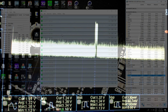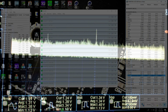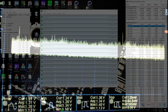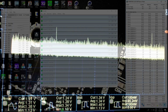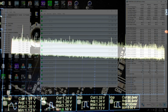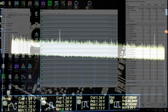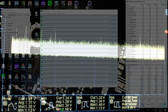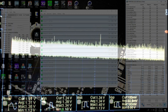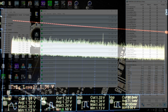There's no downward spike because this has full Vdroop, and I think ultimately, if we look at our VID reading right now, okay, no, the VID reading is not okay. That's not what I was hoping for. So yeah, I don't know how Gigabyte implemented it, but it is so cool in my opinion. If you disable all your power management, it actually behaves like static voltage, which is great. For the sake of overclocking consistency, having no power savings running is super convenient. I am really, really impressed by override mode because this is insane. There is no undershoot whatsoever.